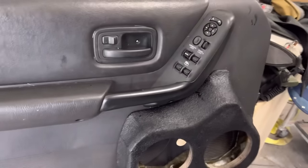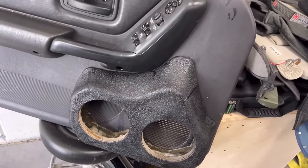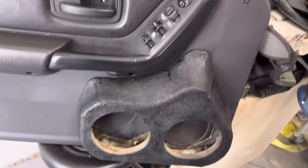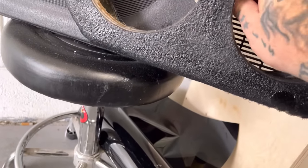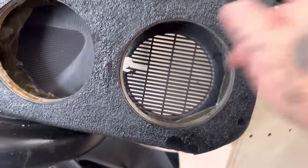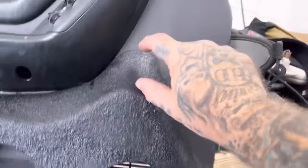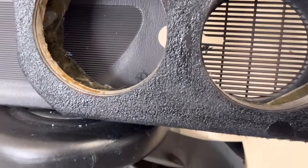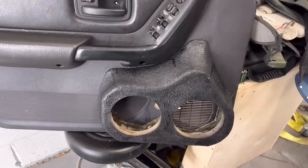I just did black. That's not paint run — that's where the resin ran. I said to hell with it and left them textured. In reality I should have gone back and sanded this, but I didn't even prep for coming out here until this morning and I wouldn't have had time for my Flex Stone to dry and then paint. So I just hit it with some Walmart black spray paint — the cheap stuff. I drilled two holes with step bits for my two wires to come through. I used most of the factory door panel, drilled some holes, sat the pod on, lined it up and drew around it with a pencil, drilled holes that far in from the pencil line, then flipped it over and used that for my self-tappers. You can see them coming through right there holding it. I'm getting ready to stick this one on and run my wires through.